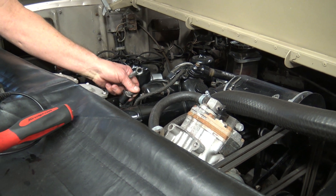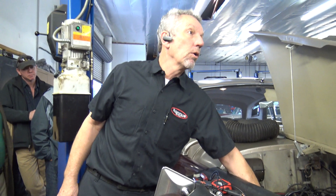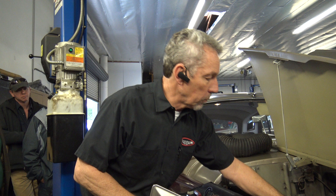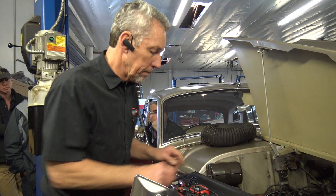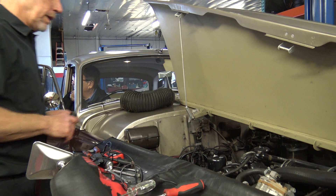So this is the heated air tube. Now if you take this tube and disconnect it and it just flops around, what that means is the tube is broken. So that's a big problem because what it'll do is it won't take the heated air — it'll take outside air and suck it in, because there will be a vacuum at this port right here. Same thing on a shaft, yeah.